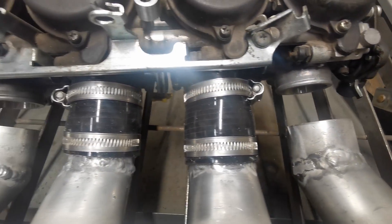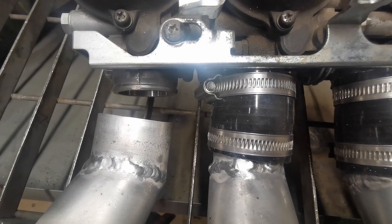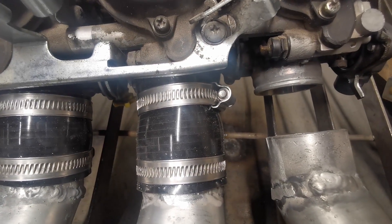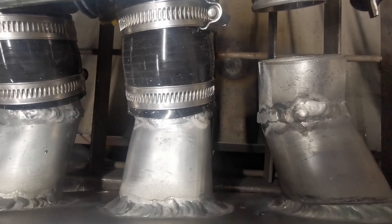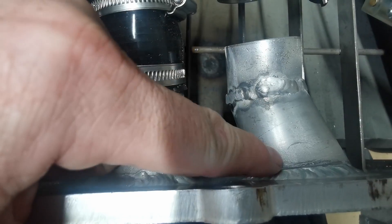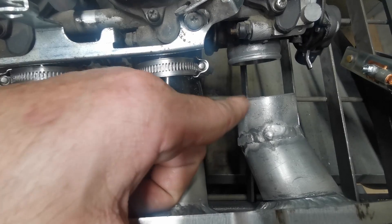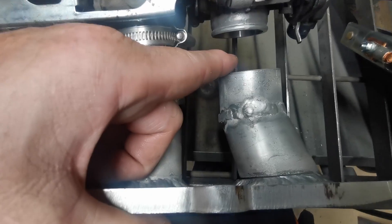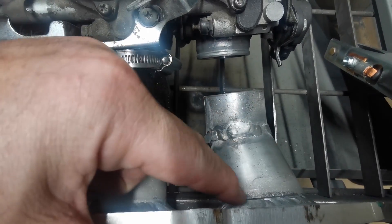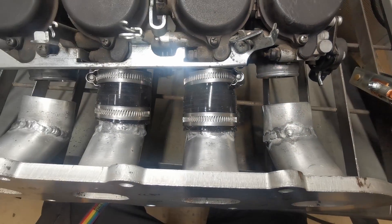As I said, I wanted to move these over so that they fit better, and that is exactly what I've done now. It's not perfect, but with the silicon hoses on there it's fine. What I've basically done is taken the bandsaw and cut a wedge out of there, which has allowed me to close that gap. It used to be further up here so it was level, and I basically took a wedge out there, pressed it together, and now I can just run a bead of weld around there — and that's it basically, then I will be done with this.